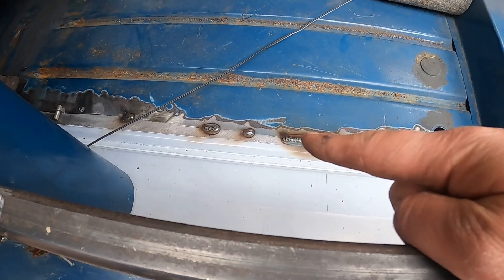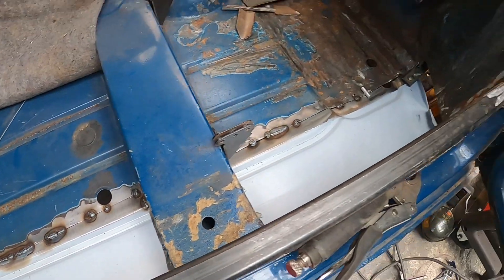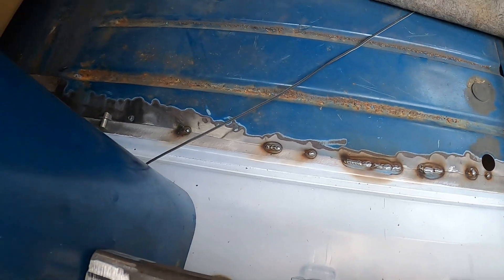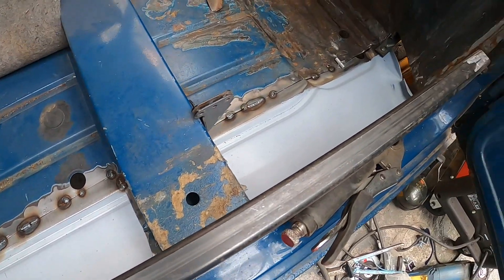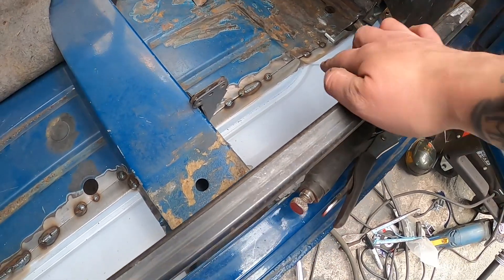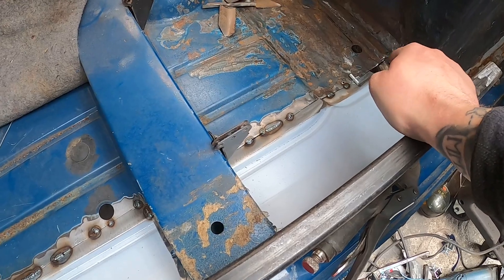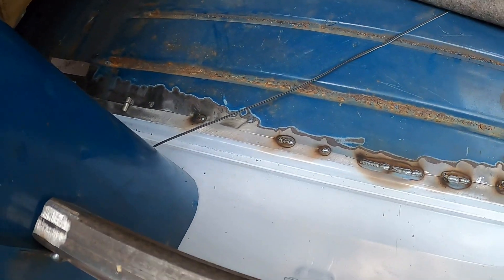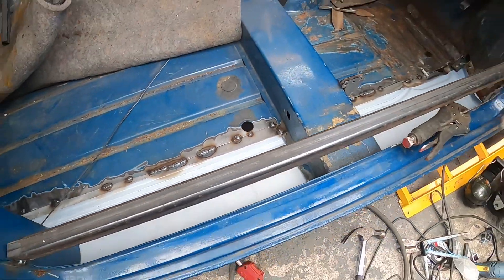Alright, so that's it tacked in all the way along, and I've started doing a few stitches. We are getting there. The panel welds really well — after-market machine panels do weld really well. It's just obviously taking a bit of time to get in, but it's looking good. I'm going to get all that welded along and hammer and dolly that profile back in, but we're getting there. Nice heat penetration for all the welds as well.